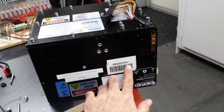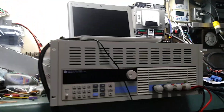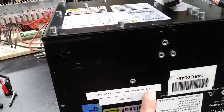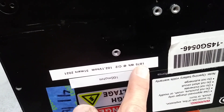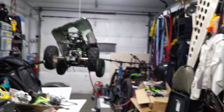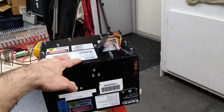The plan is to save this battery, but it's an old one from 2014 — already seven years old. I measured it with this big electronic load and it's only 1.8 kilowatt-hours out of the rated ~2.3 kilowatt-hours, and I only got 1875 watts of power. So it's at the end of its life, but for a small ATV it will be perfect. The only problem is it's 28S — about 102 volts — I don't want to put that voltage on this ATV.